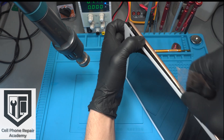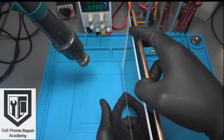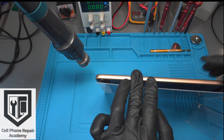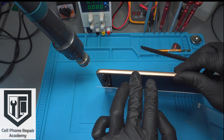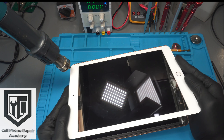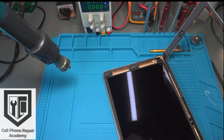Once I go over the home button area, I will retrace the left side of the iPad with the film and slightly separate the screen from the housing. There is still adhesive in the area of the home button, so we create a gap with our fingertips, get a spudger, dab alcohol on its tip, and work our way around the frame to loosen the last bit of adhesive. Keep applying heat while you insert the spudger with alcohol. The right side of the iPad is still fully sealed, so we gently lift the left side of the screen while applying heat to the right side.